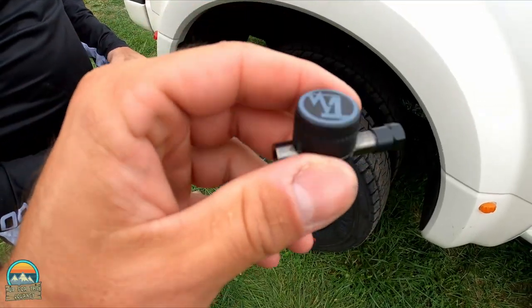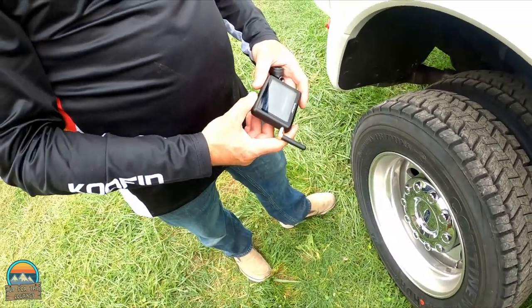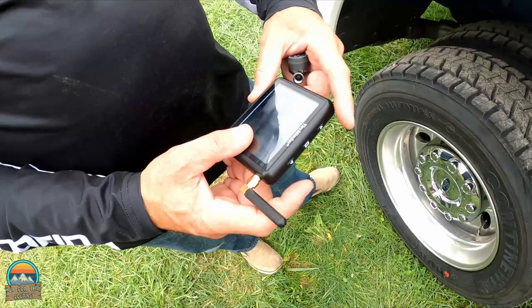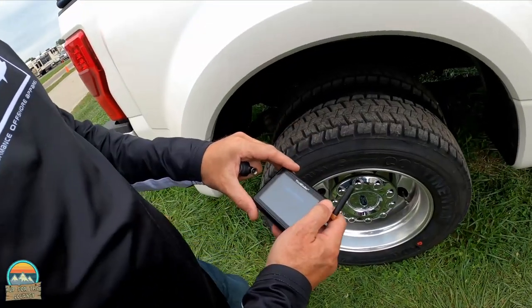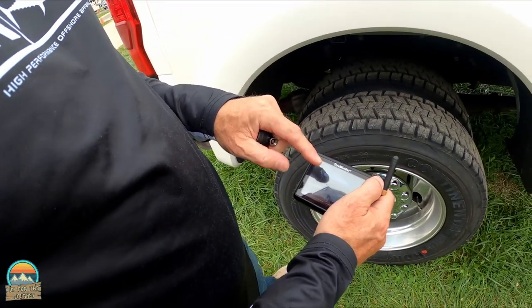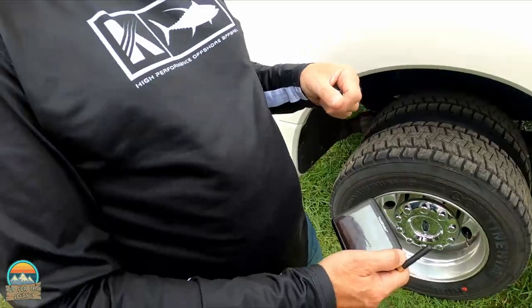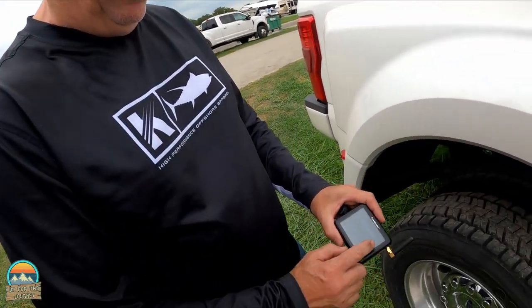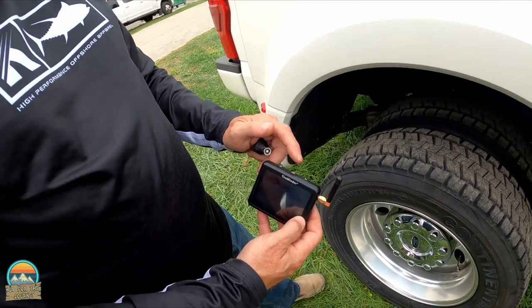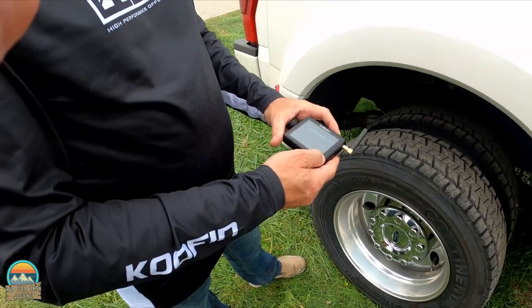First step is put the battery inside and then go into learning mode. You hold the two arrows down and the display will go from M to L, which is learn. We're going to reprogram the whole front screen to be just the truck, so we'll delete the four RV sensors. To delete, highlight the sensor in learn mode when it's flashing, hold down the center button for three seconds and the number will disappear to zero. Then just cycle to whichever one you want to delete.